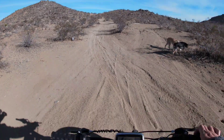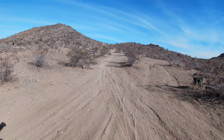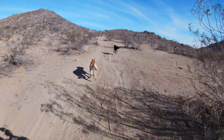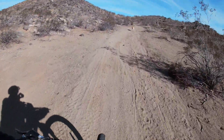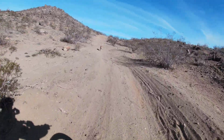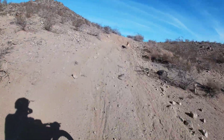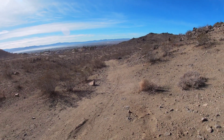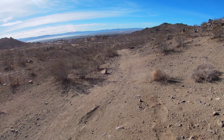We've got an uphill slope coming up and this is where it will be really put to the test. Last time I went up here I was skipping quite a bit, to where I had to actually walk it up. I made it up this slope without the bike skipping, so that was the problem — the main gear. By replacing the sprag clutch, I was able to resolve the problem.